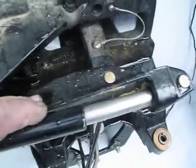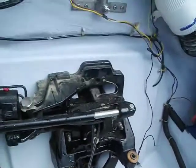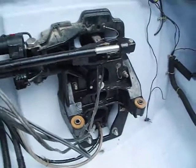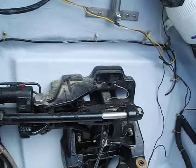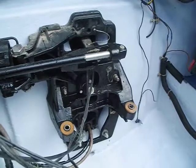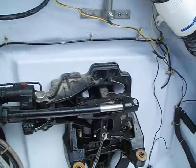And this is the arm right here that moves back and forth when you steer it, and that's connected to the steering cable that goes up front. So when you pull the motor out of a boat, there's no need to change anything on the steering system. He made note that when we put his motor back in, the steering wheel wasn't in the same place — but there's nothing that changes on any of the steering system when you pull a motor out to put a drive coupler on, because you don't take the transom assembly apart or off or change anything.